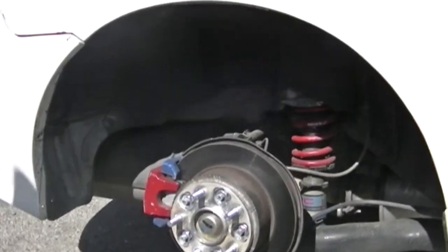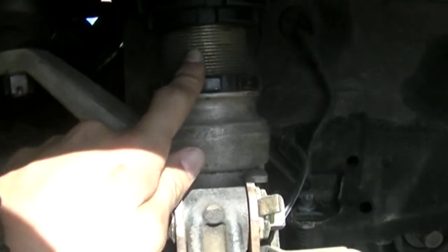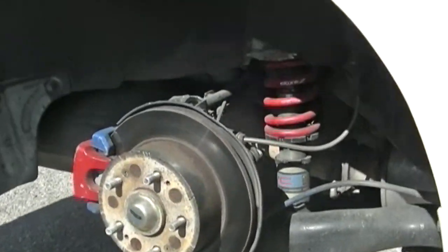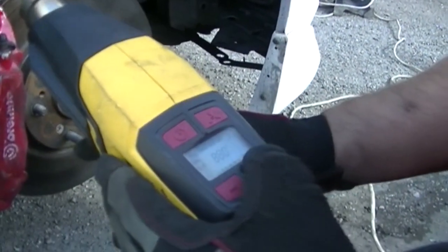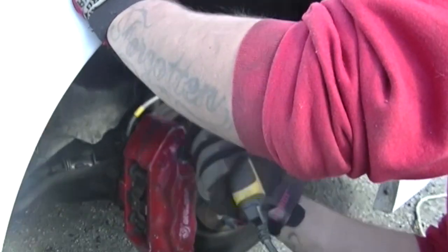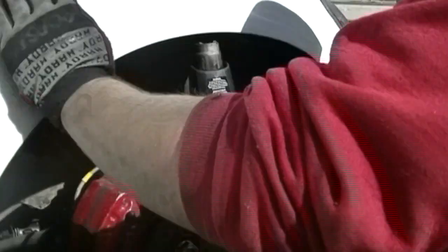Come here to Backyard Dreamers and we'll give you that magic touch to your cars. As you guys can see, the Brembo calipers — look how high these are right now, and at the end these are going to be all the way down here with the right fitment, the right poke. Wouldn't even need a spacer for them. Come get your professional fender rolling. You always want to make sure you heat it up — we have it right now because the sun's out, we have it at 660. If it gets really fresh, we can put it up to like 1200 or something — you can see the numbers climbing. That prevents the actual fender from cracking. The only downside is that you can burn the paint, so when you do it you have to literally be moving constantly.